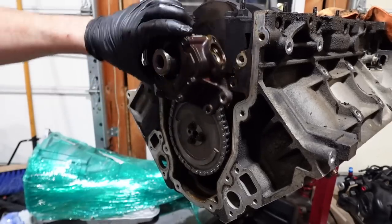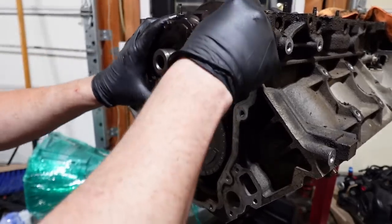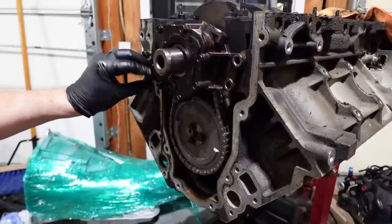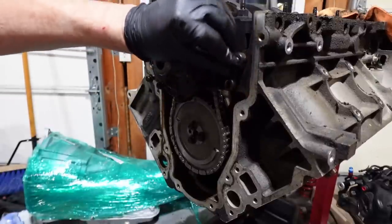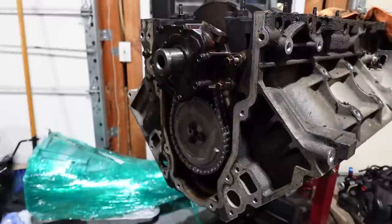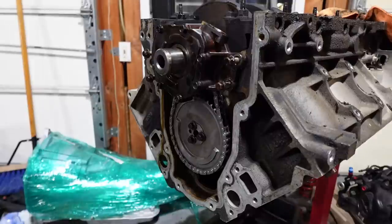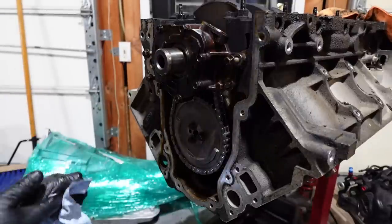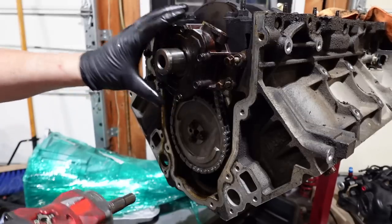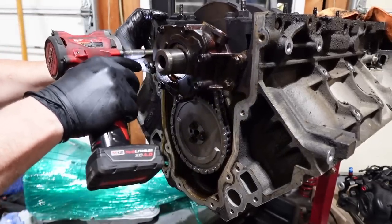I'm very curious if I can make this thing an oil pressure master. I'm curious — is it the bypass, is it the worn-out oil pump, the pickup o-ring? The pickup o-ring is pretty easy to screw up and if you have one that's falling in and out, I'm pretty sure I've done that enough to make a point. I hear there's a way people put shims in every corner to have the perfect amount of dead space — we are not doing that here.